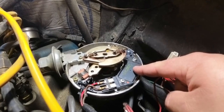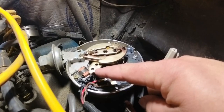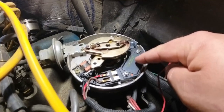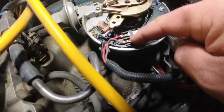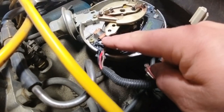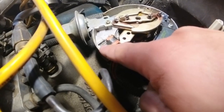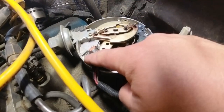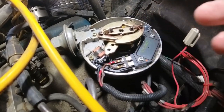With the cap and rotor out of the way, here's the ignition module. You may have to bump the starter just to make sure the distributor rotor mounting tabs are out of your way so you can get this out nicely. You've got the connection for the magnetic pickup over here and the module itself. For some reason, the plastic piece is missing — it had issues staying connected, I've got it over on the bench. And there's the condenser, noise filter, whatever it is. Three screws, it all comes out and plugs into the new module, plus a ground right there. Easy swap.